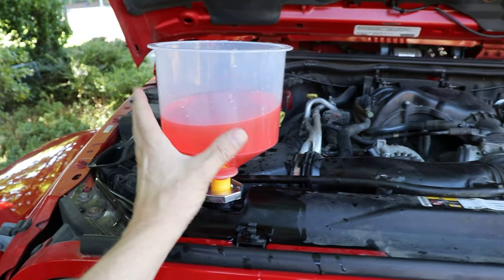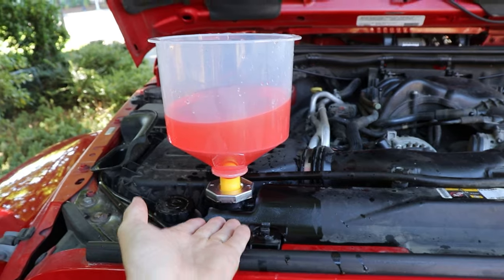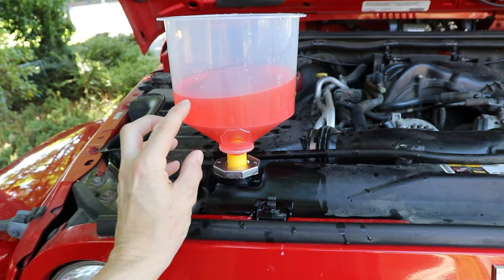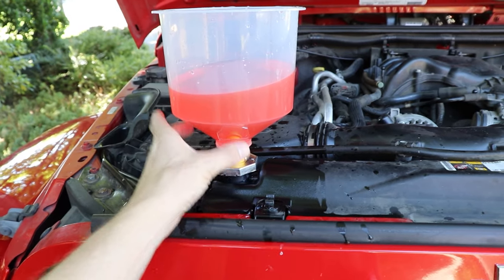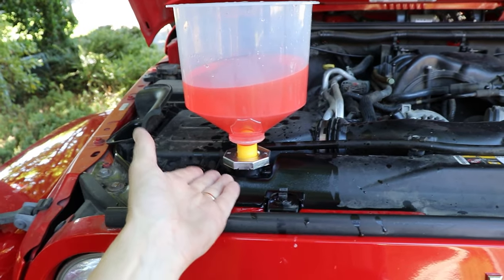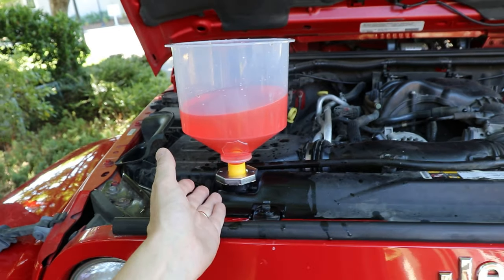It was not bubbling any gases out of the funnel. That'll be a sign of a blown head gasket — if you're getting exhaust gases bubbling out of here. I don't have the exhaust test kit, but there's a super handy kit you can get for this — I will link that in the description below. It's just a little kit you hook up, add a little fluid, and test it. If it changes colors, then you have an exhaust leak. Hot exhaust is getting into your system, and that'll cause you to overheat as well.